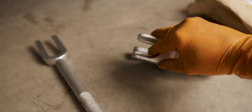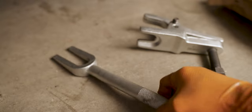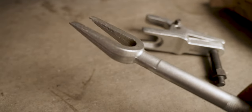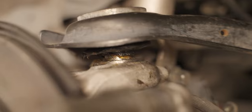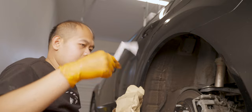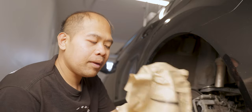This area here is too narrow as well. Then I had to rent the pickle fork, and this did not pop it out either. It just ruined my ball joint, which I should have known better. Hopefully this new one I bought will work — it's very similar to the Honda tool that was recommended in the instructions. We'll see if this one works; as you can see it's a different style, much wider. Fits way better.